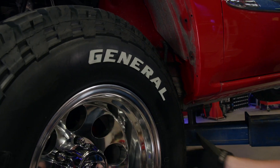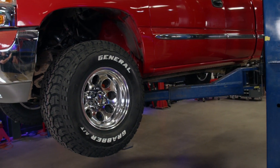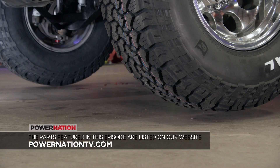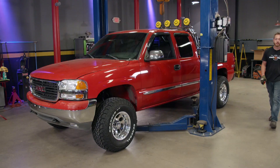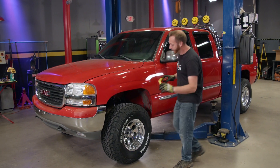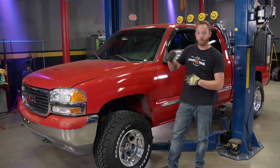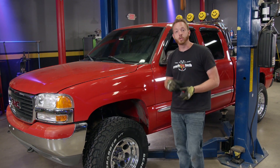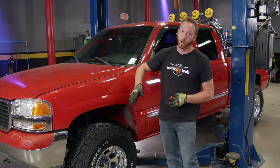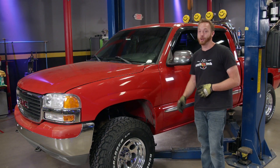When the wheels are turned, there should be no rubbing at all. So the next thing to do is get that back tire on, get the truck on the ground, and see how our old-school cool Sierra is going to look. With the weight of the truck finally back on the suspension, at first glance, it appears that the front end is sitting just a little bit too high. According to the tape measure, it's about an inch higher than the rear, which isn't going to fly. We don't have enough up-travel of the suspension, so all I've got to do is decrank the adjuster bolts for the torsion bars a few turns to lower it down so it's level, or maybe about three-quarters of an inch lower in the front. I really like how that looks. I'm digging the stance with the new wheels and tires.